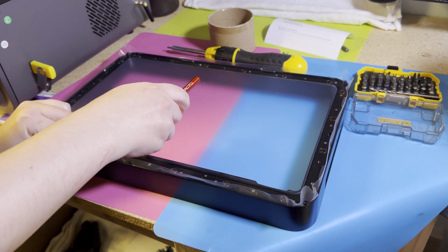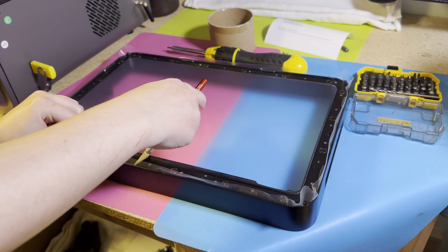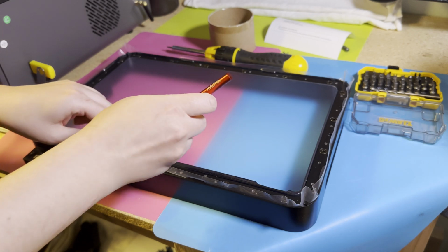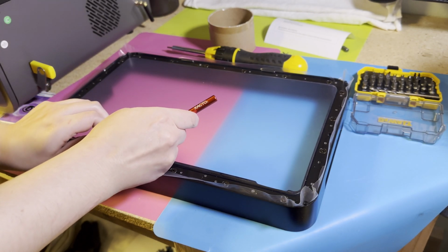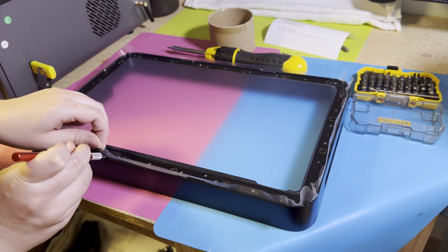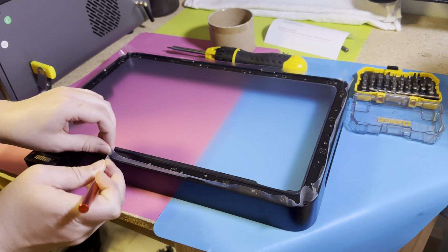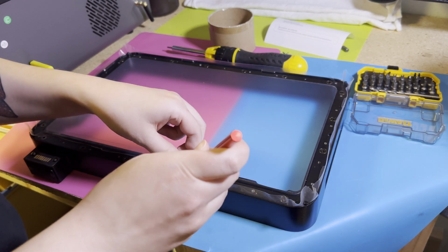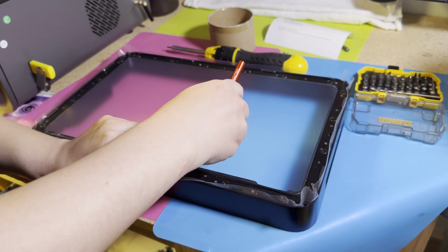And I won't lie to you, this process does kind of hurt your wrist from all the twisting. So if you have an electric screwdriver, you can use that, but make sure that its clutch is turned as almost as low as it'll go. That way you're not just sending these relatively weak screws into, again, relatively weak metal, causing either cross-threading or just stripping out the screw altogether.